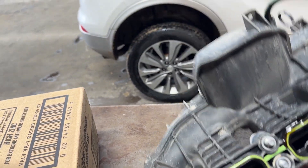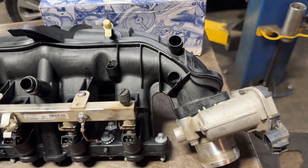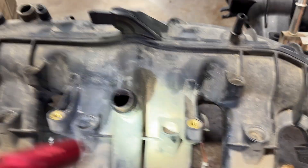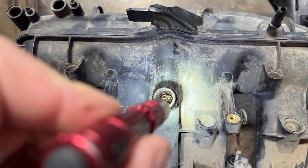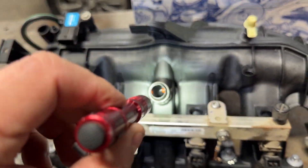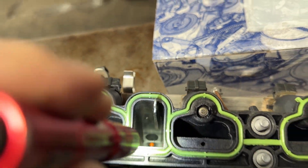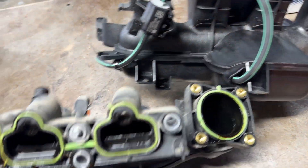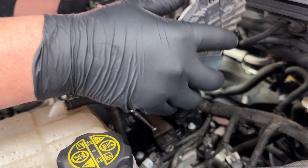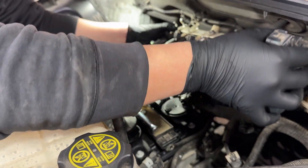Here's what goes wrong with this intake. See that orange piece in the back — that's like a check valve. On this old one you can hardly see it, which means the intake is either too dirty, too sludgy, or that check valve has broken. That's what causes your PCV or valve cover diaphragm to fail — you'll start hearing hissing from the valve cover. That's why whenever you replace the valve cover, you usually have to replace the intake as well.